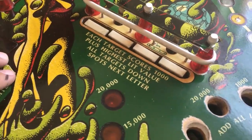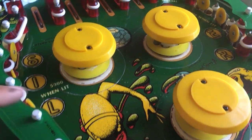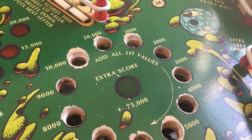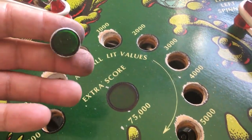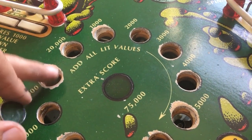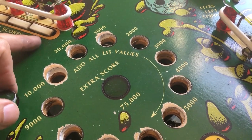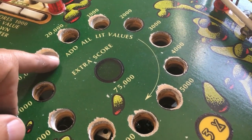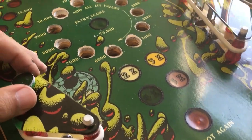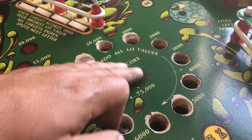This one is lifted a bit, and this one over here is lifted a bit — I have to take care of them. Silver is fine, Quick up top is fine, but here in the middle, as you can see, I have actually removed them all because they had been shrunken over the years due to the lights getting too hot and ruining everything. Every time the ball rolled over these, it would change direction or just get stuck. Really a mess — really project pinball machines.